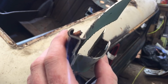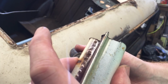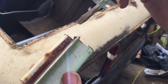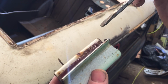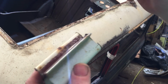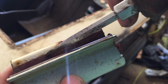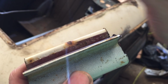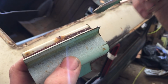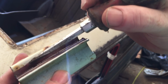So what we're going to try and do, there are different ways of doing things. Obviously you can attempt to drill out the spot welds if that's how you like to do it. Somebody also told me that it's actually roller welded. So basically I think you have two wheels, nearly 2 metre wheels, and they go round and do lots of little spot welds, and that's what you can see there. I think this has got lots of what look like little spot welds, so I don't know if they're all done like that. If that is, ignore me about spot welding. Obviously if you pick up a car that's been restored, it might well have been spot welded. We're going to spot weld it because we don't have one of these welders. So basically, yeah, it might be quite tricky to drill them out. You can try.